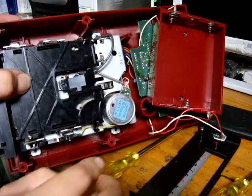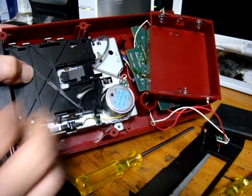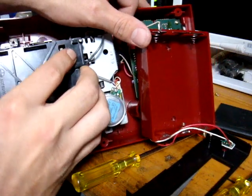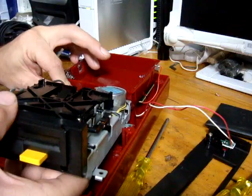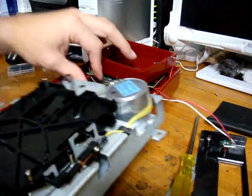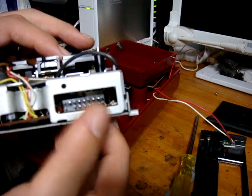Now you have the main bits of your disc system. Once you get inside, you're going to notice there are four screws holding your system in place. Take those screws out and your tray is going to pop out. It's connected in the back by wires, so hold the system firmly with one hand and with your two fingers try to wiggle the cord off the back. It's going to be really tight, but try not to wiggle it too much or you might bend it. Make sure none of these pins are bent when you put it back together — that's very important.